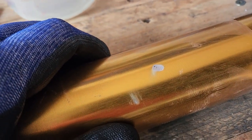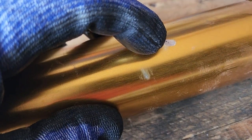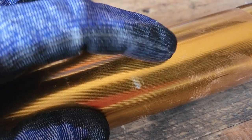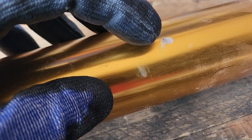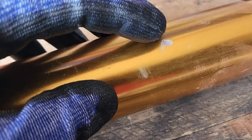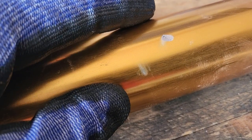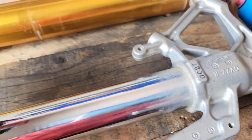If you're looking from the front of the motorcycle, this is the right-hand fork, and this is where the brake line goes over. After 14,000 kilometers it has worn into it quite a bit. When I reassemble, I'm going to find where this line is and put some spiral piping or tape around it as a sacrifice so it doesn't wear any further. This is a design flaw, unfortunately.